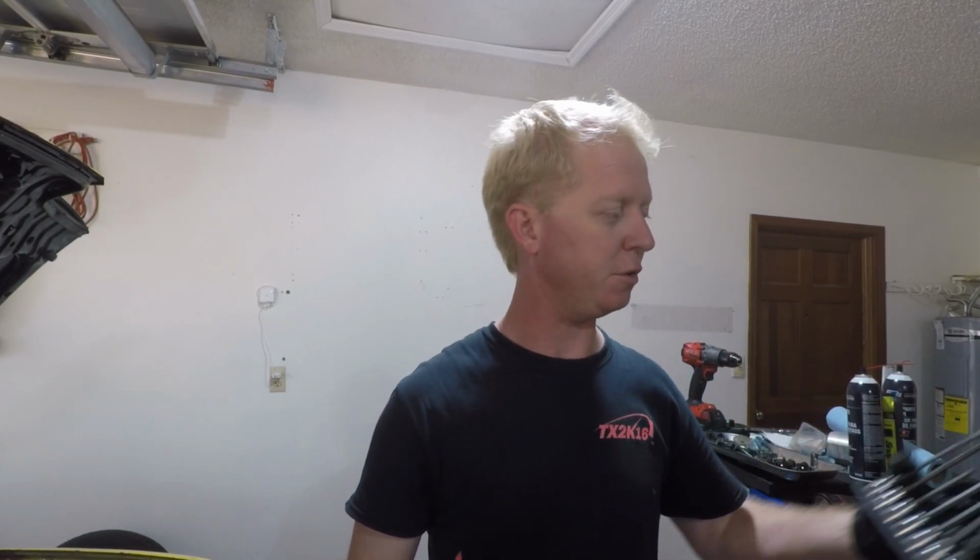Alright, so let me catch y'all up to speed, because it's been an entire afternoon battle. Unfortunately, sacrifices had to be made. Things went south quick. The problem is the ARP studs do not fit through the dowels. Wasted about 4 hours trying to get those dowels into the block. It was not fun. Like I said, sacrifices had to be made.